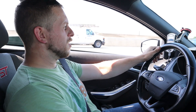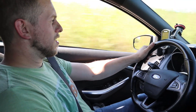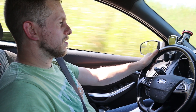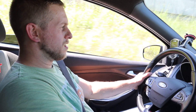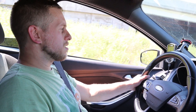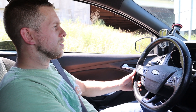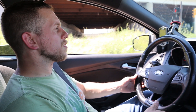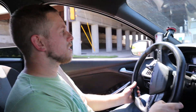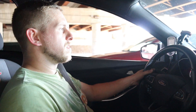How's she feel, homie? Feels good. Octane adjustment ratio is back up to a full negative one. We did throw a negative three on cylinder four — really should have been data logging to see where that happened, but it was definitely during one of the pulls. Probably still working out some of the bad gas kinks. I had a little bit over a quarter tank of gas, plus we're on a bumpy road. I've never really thrown a negative quite like that, but looking more for consistency — and across the board it seems like this has already helped improve. Yeah, it's definitely improved. It's definitely fixed a lot of the issues.